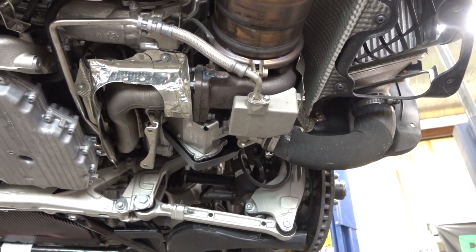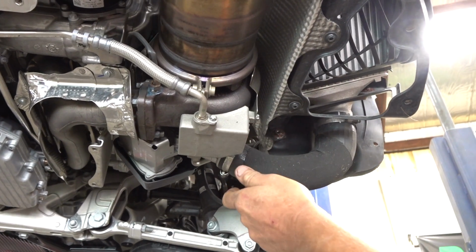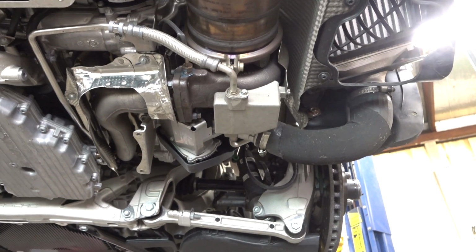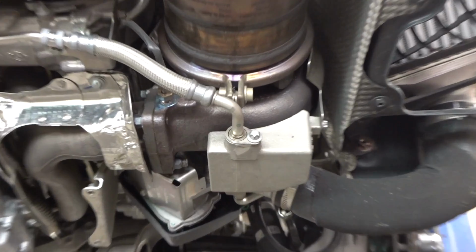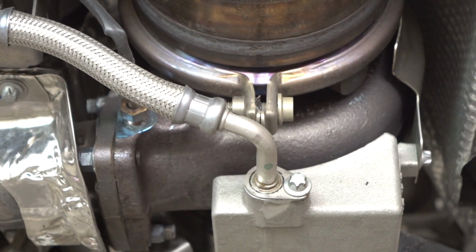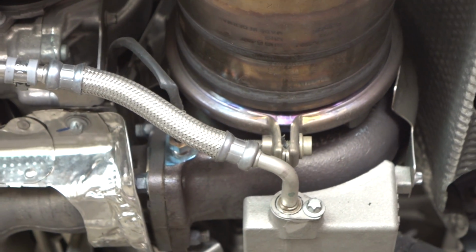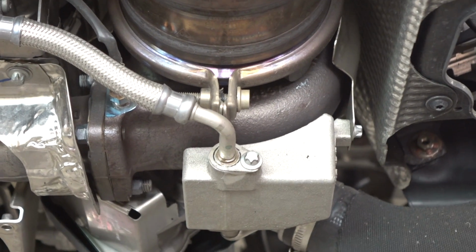And because it's a VGT turbo, this variable geometry turbine section, the throttle response is just as good as the 911 turbo. As a matter of fact, I believe even better. The throttle plate movement is just matched, just like a motorsport. It's nice and linear, progressive. Any little changes in the throttle doesn't upset the car because of that. And the turbine speed perfectly matches the throttle opening. Really incredible.